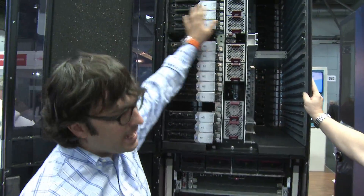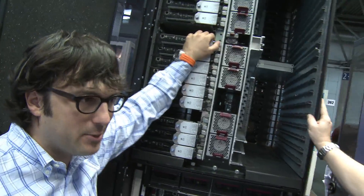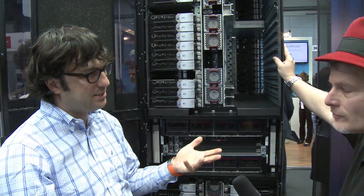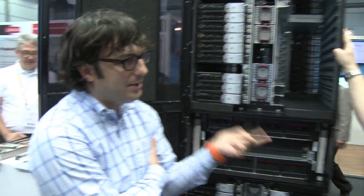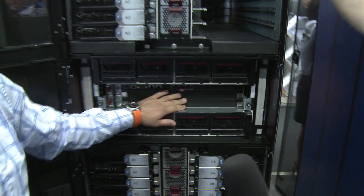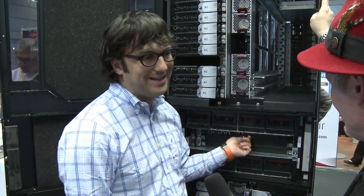The rack is divided into eight cells. In each cell you get 10 trays, and in each tray you get two nodes — so that adds up to 20. But what we do is take the 10th tray and put an integrated switch in. That allows you to have 18 nodes connected into your 36-port switch. 18 ports go through the back to connect your leaf cabling, and 18 ports go to the front on QSFP to build your uplinks. That reduces cabling, complexity, and speed of deployment — your cabling cost is much reduced, and it just makes it a whole simpler system. We do the same thing on Ethernet as well — that module in the middle will give you the integrated Ethernet switch. You get 144 ports of gigabit for your administrative or boot network, and then you can go with 10-gig or 40-gig uplinks, all built in.